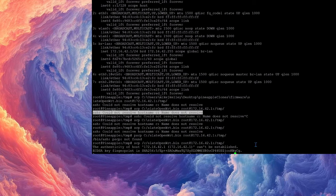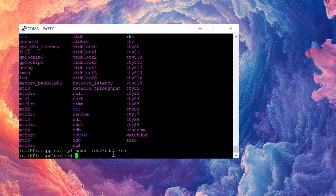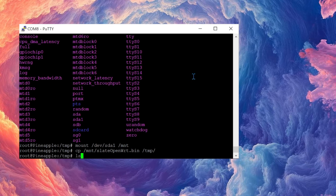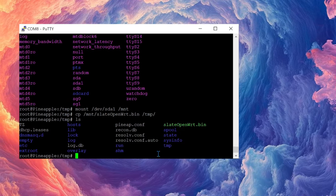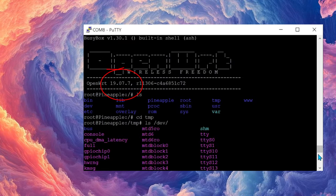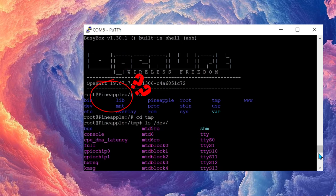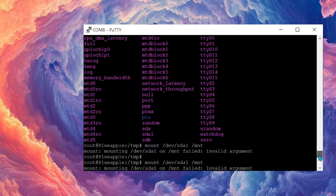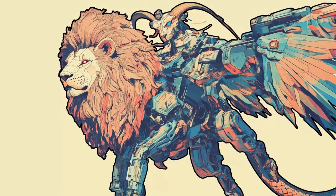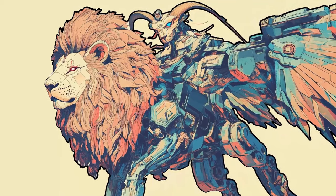Unfortunately, I wasn't able to secure copy the firmware onto the router. However, I was able to sideload OpenWRT firmware 19.07.7 from the USB using the following command seen on screen, also available in the description. Then I flashed it with the following command. Rebooting seemed to indicate that I now had 19.07.7 firmware installed, but I still couldn't access a web UI. Worse yet, I no longer had the ability to sideload firmware from the USB. It seemed I had created some sort of weird hybrid firmware as a result of attempting the factory reset and subsequent flash.